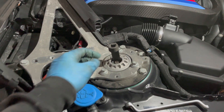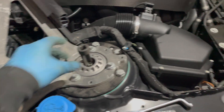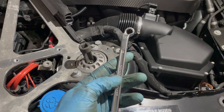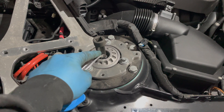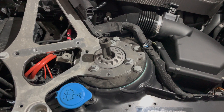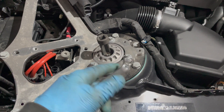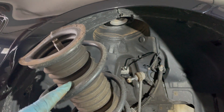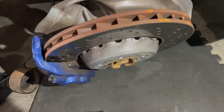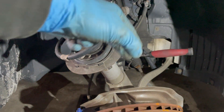Now that we have the bottom taken care of, we're going to look at the top. For this you're going to need a special tool — this is a pass-through 18mm, which goes on top of the strut nut. I also like to use one of these bent box ends and grab a 10mm to hold the top of the strut so the strut body doesn't move as you're turning this. You will need to special order this, but go ahead and get it on Amazon — they're pretty cheap. With the strut tower bolts out, you can basically just pull it out the bottom and fish it out. I usually put a pad there just as a safety precaution. For the back of the strut you will need a strut spreader tool — it's an oval shape and it widens as you tighten it, so you basically half-turn or quarter-turn it and it spreads the housing so you can pop it out.